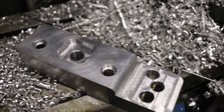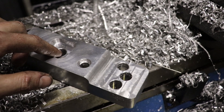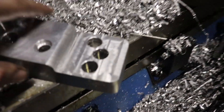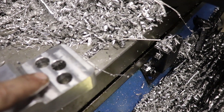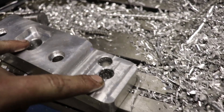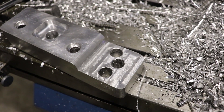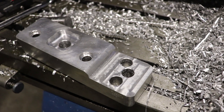Right, so there's a bit going on here. Strut mounts, ball joint hole. A few different tie rod pickups for different lock settings. The center hole is the one I'm going to run — that's a pretty standard for me, 95mm center to center tie rod pickup. This is what I use on nearly every set of knuckles.